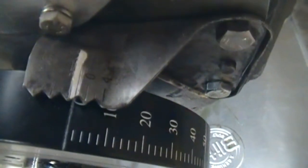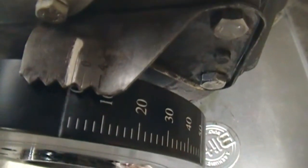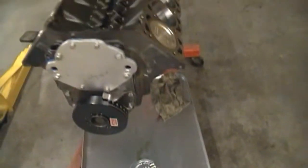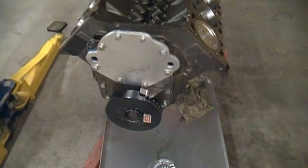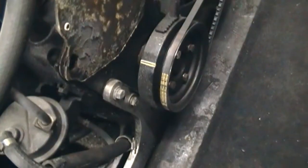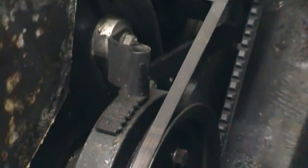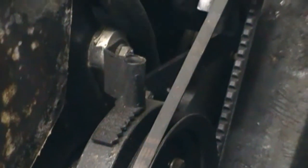I don't know if you can see this or not, but the zero was actually off on this. So I cut a line in this indicator and highlighted it. And that's actually only temporary to know where that's at on those bottom four bolts of this timing chain cover, because that's where the engine mounts in the bolt. And I may even go ahead and use this indicator, which is a little more adjustable than the one that's on there.